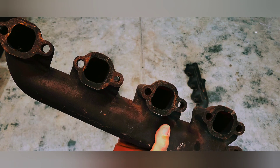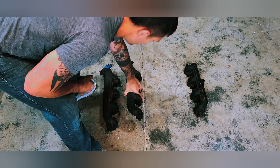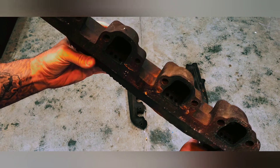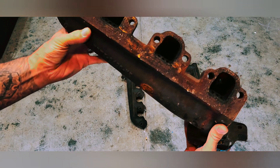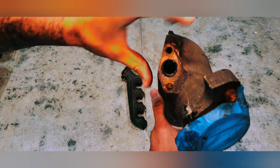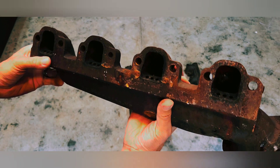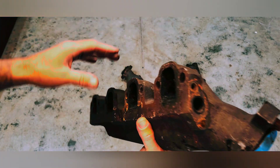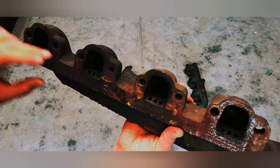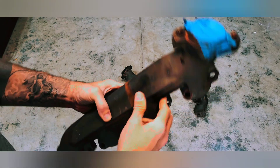This is a passenger side manifold, and then this one here is also a passenger side but air-injected, so it's got those little holes underneath the ports. It's got a long runner that runs down through the end — basically a tube — and I removed the valve or fitting that was right there. These would work fine; I would just block this off or weld it up, and weld these holes up. Or you could get creative and put EGT probes in there. They're definitely usable.